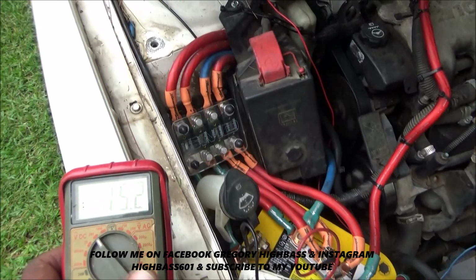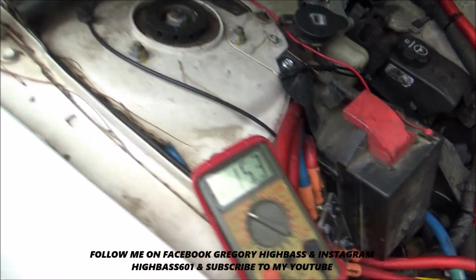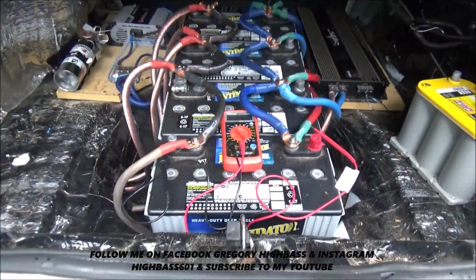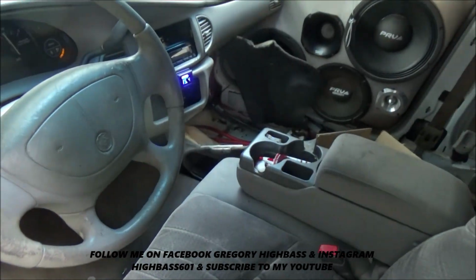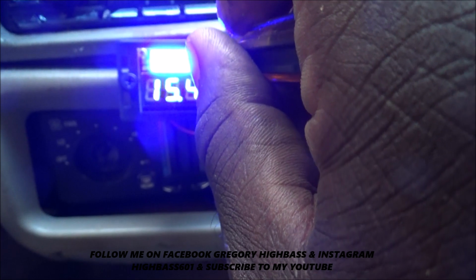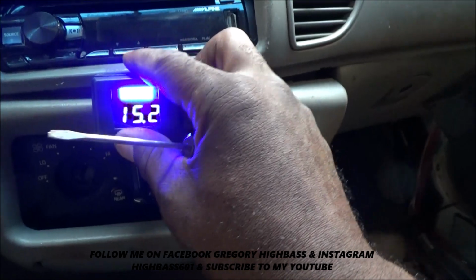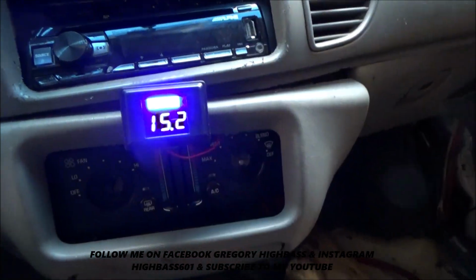Okay guys, so apparently the air conditioner was on or the heater was on, because it wasn't blowing cool, but we get some more volts out of it now. That compressor had everything pulling. So yeah, we're getting 15.2 now, so looks like I'm gonna have to adjust something. So it's saying 15.4 in here, that's not right. I'm gonna bring this down to 15.2. That's gonna work.